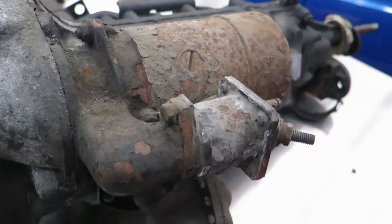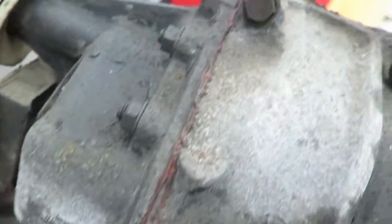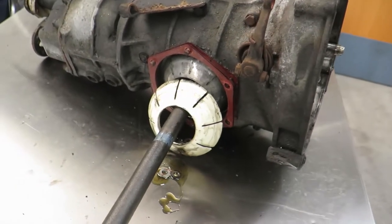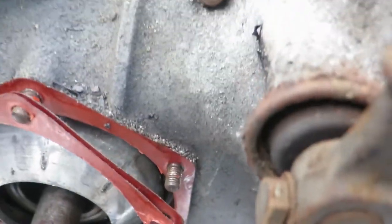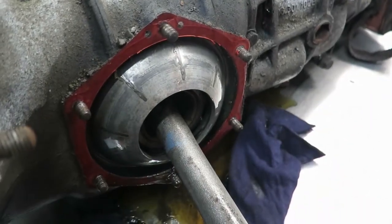I'm going to whip the starter off, whip the axles off, get the clutch release bearing off, pull that end housing off and see what's in there, then split it in half. Turns out the axle tubes come off like that and that looks like it's part of the actual gearbox housing itself. This plastic nylon thing just clips on. It looks like they use the gaskets to set some sort of clearance because there are multiples of them on either side - this one's got three and this one had three or four. We'll work that out when we're putting it back together.